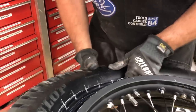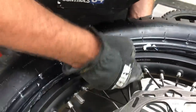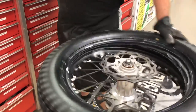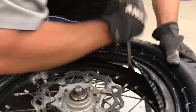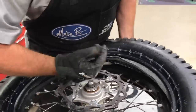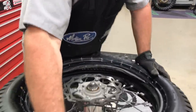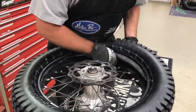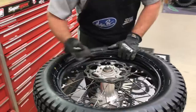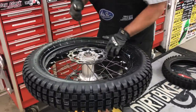I'm going to push the tube out of the way, get the rim lock under the tire and feed it on just like that. Also making sure the stem is in the tube. I've got about two-thirds of the way on. These trials tires are pretty easy to install — I'm not going to pretend they're really hard. I just lift up with my left hand from underneath. My left hand is really helping me feed it on. Now I'm going to make sure the tube is all the way in here. With that extra tube in there it makes it a little bit more challenging.